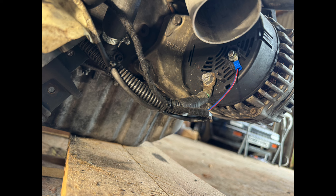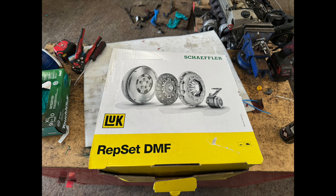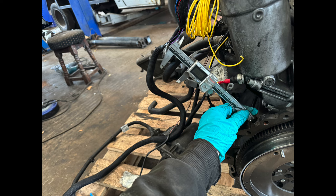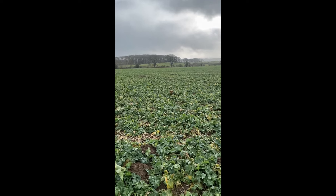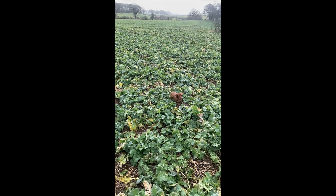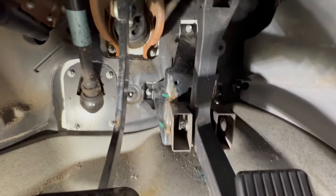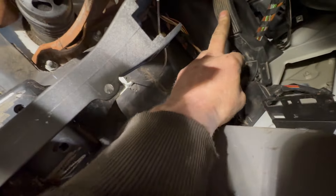Also leave the alternator wire in — it's blue with a red trace. This is the clutch and dual mass flywheel I've used — I'll put a link in the description. This is the flywheel sensor from the original engine. You need to measure the depth of where it's going in so it doesn't hit the pickup teeth on the back of the flywheel — sometimes you need to space them off a touch. Also, you need to trim the back of the sensor where it meets the gearbox, where it bolts down from the top, because it protrudes slightly and the gearbox will squash it and destroy it. I've used an early throttle pedal so I can run a cable, but leave the old electronic fly-by-wire pedal plugged in and bolt it under the dash. This way, the ABS still works.